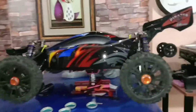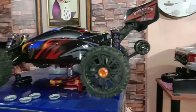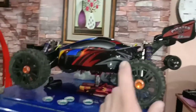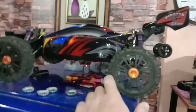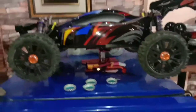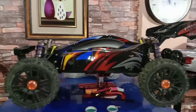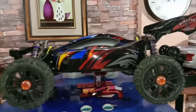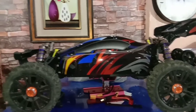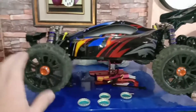Here's a big eighth-scale ZD Racing that was a roller kit — a monster truck. I didn't like it: the tires were 170 millimeters high, it was clumsy, and it did a lot of cogging. So I bought buggy tires for it and it made a total difference — it really carved the corners around our track. I bought the wing, wing mount, and body, left the wheelie bar from the monster truck, and chopped off the top of the monster truck bumper for shock protection. I had a big 150-amp Surpass Hobby ESC but that went up in smoke on the first day on just 3S — rated for 6S — and I see a lot of YouTube videos of those going up in smoke.